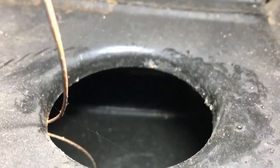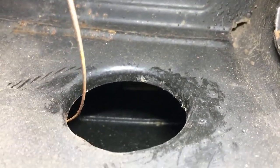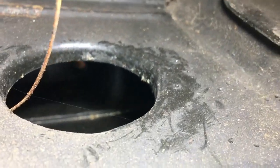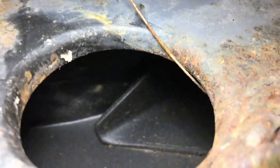You can see, I mean the camera's obviously focusing on the outer wall of the chassis, but you can see inside there it's all clean and rust free. You can see the wax built up in the edges, and up inside this outrigger you can see it's doing a fantastic job. Then when we look at the outside of the chassis, it's a right mess. Can't really see inside anywhere else. You can see inside here, see inside there that it's done a good job. Everything's good. You can't really see inside anywhere else at all.